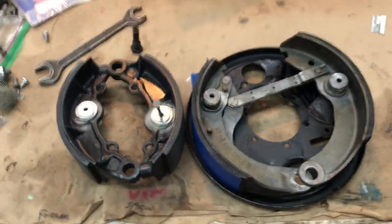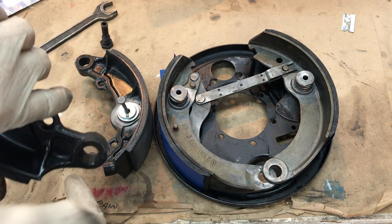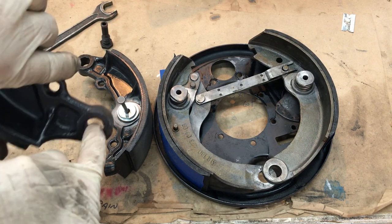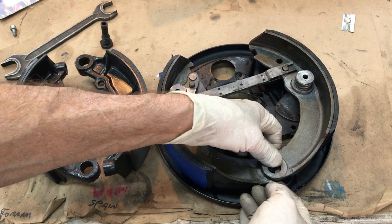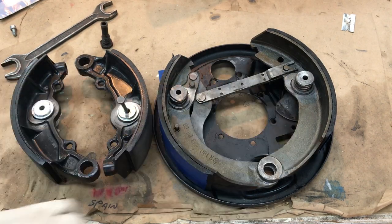Make sure you have good smooth holes for the pin to pivot on — this is one place you can apply some lube. These are notorious for aluminum oxidizing against the steel pin. You can also put some lubricant on the pivot surfaces, but you do not want any lube where the friction disc contacts the metal — you want clean metal-to-friction-disc contact at that point.